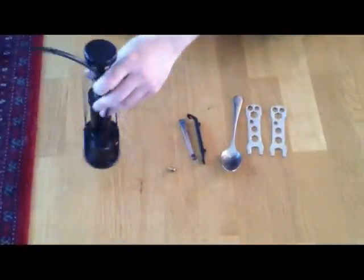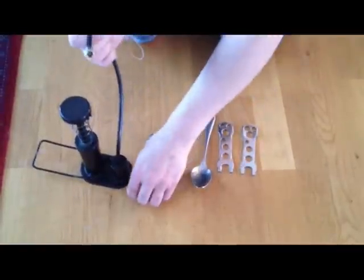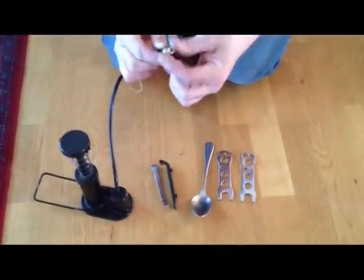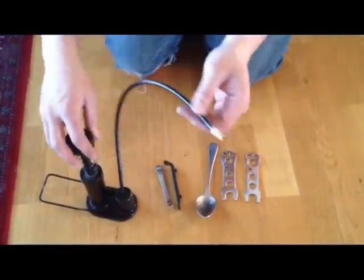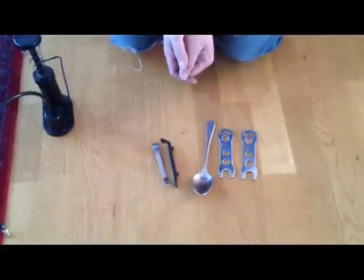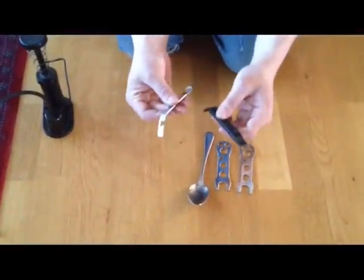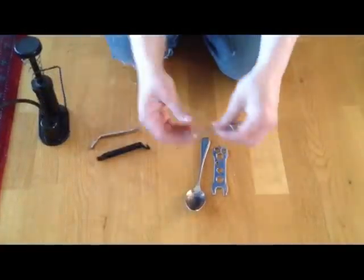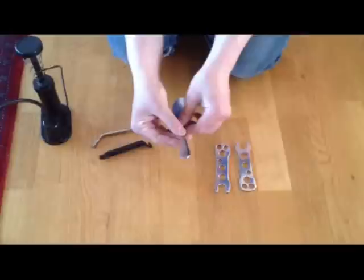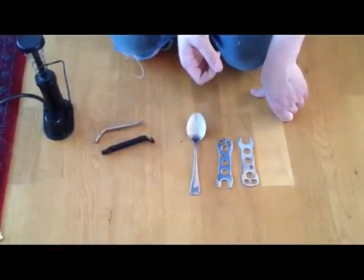In order to switch out the inner tube, you will need a pump. This one is set by default to be used on Schrader-type valves, but I also have a small adapter so that I can use it on the Woods valve — it screws inside and makes the hole smaller to fit that valve type. Additionally, you will need a pair of flat-ended tools for working with the tire, removing the tire from the rim, and aiding in putting it back on. What you want to avoid is flat head screwdrivers — you will inevitably puncture the inner tube at some point and have done a lot of work for nothing.